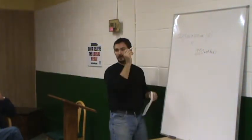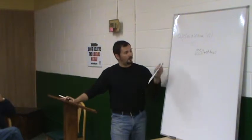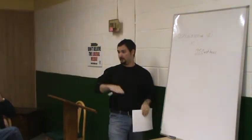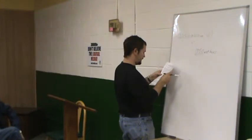1350 watt hours. It means you can run, again, an appliance that uses 1350 watts, a window unit, a window AC unit uses 1300 watts. On that one battery, you can run that window unit at that power capacity for 1 hour. And it's done, 0%. Okay? So that's one small battery, all right?